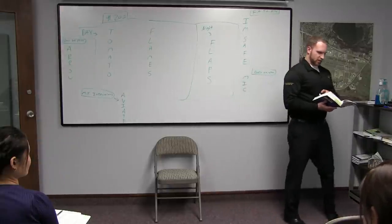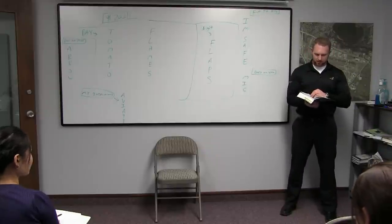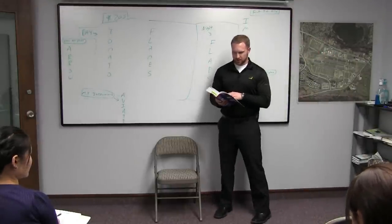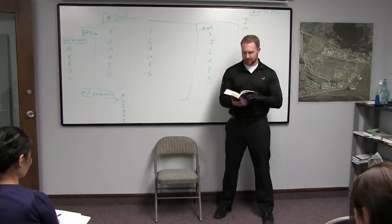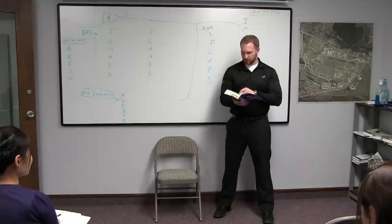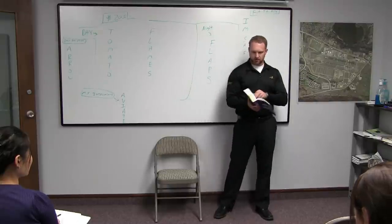So the first section we're going to go over is part 43, and some of these might not be in your highlight sheet, so just bear with me. There's a section under part 43, which has to do with major alterations, major repairs, and preventative maintenance. Under section C, it talks about preventative maintenance. Preventative maintenance is limited to the following work, provided it does not involve complex assembly operations.